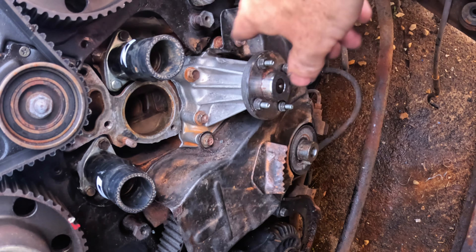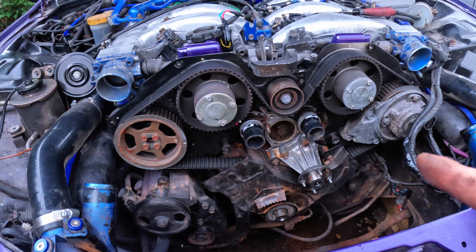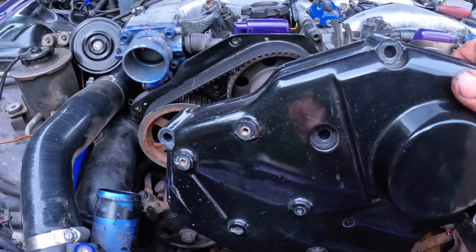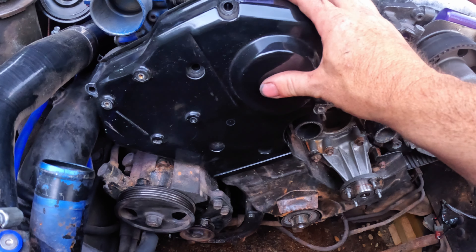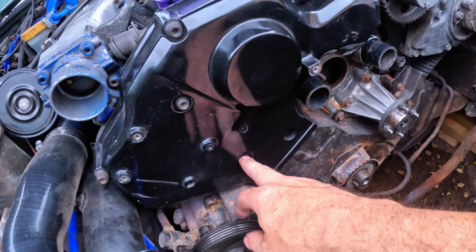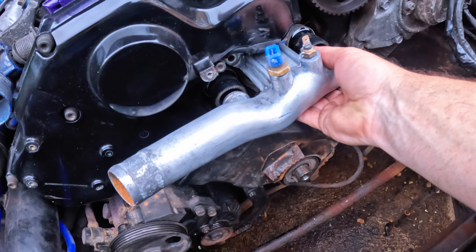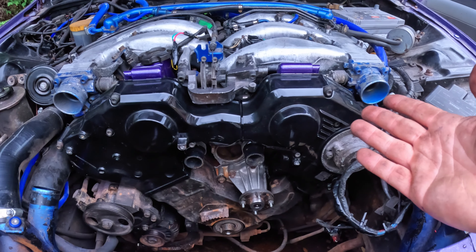The lower timing cover is back on with bolts in all positions - remember to take that one out first then put it back in. We've got to put the timing belt covers on before we put the upper rad hose on, otherwise you can't access the bolt. I've got some brand-new second-hand gloss black ones - might have a little scratch but they're not wrecked like the old ones. That's the timing belt covers installed.